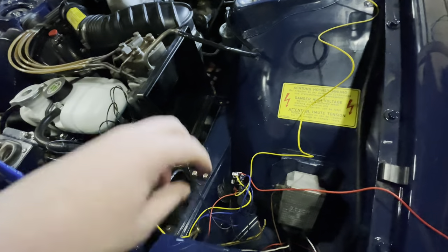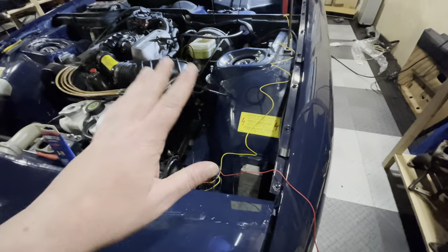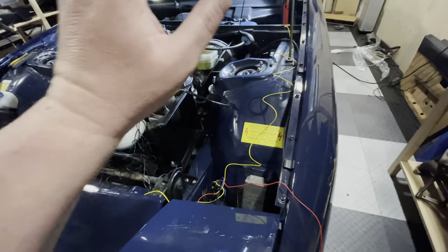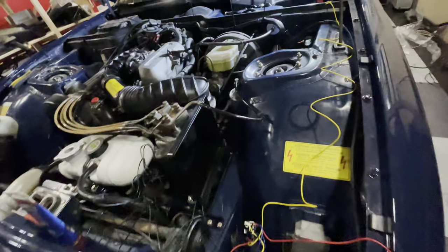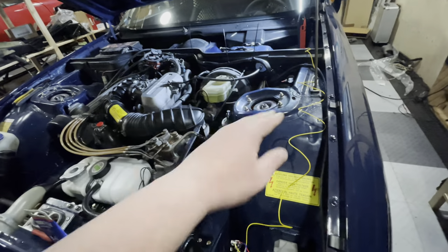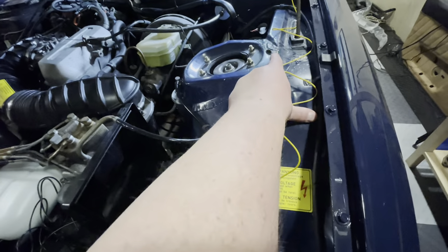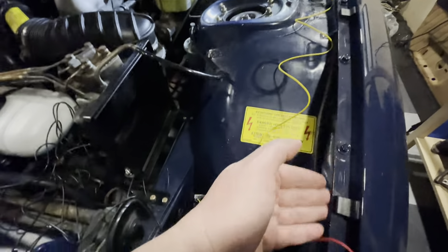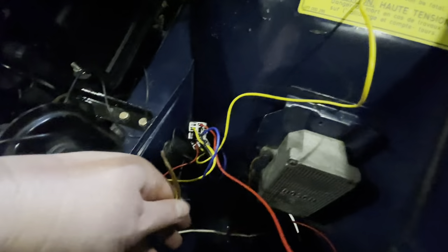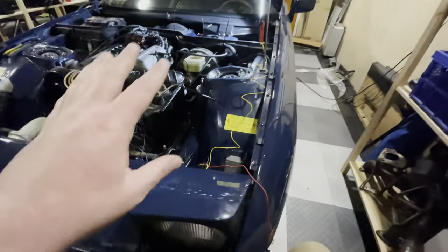So I'm going to reverse all this work, take the relays out from here, and put them into the car. I've got cables I can extend if needed. The relays will be where the car's relay positions are — they'll be dry and safe. I'll pull a wire from the battery into the bulkhead, and then the wires can run neatly underneath the fender and come into the headlights. My pigtail solution still stays intact. Let's go inside the car, find a spot, and get the wiring through.